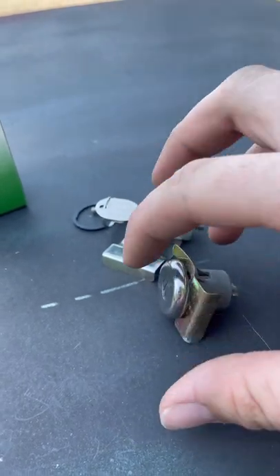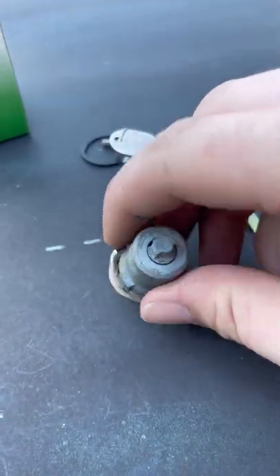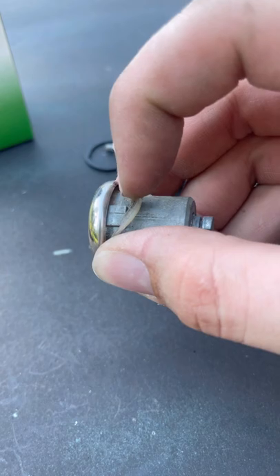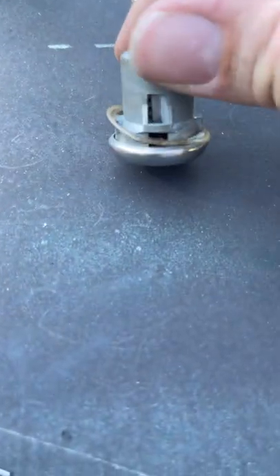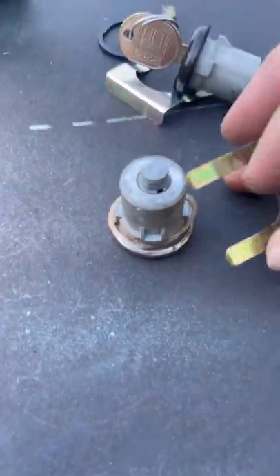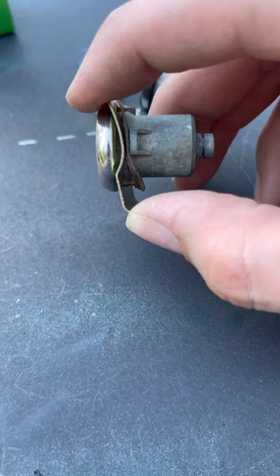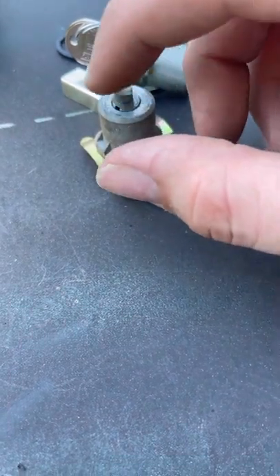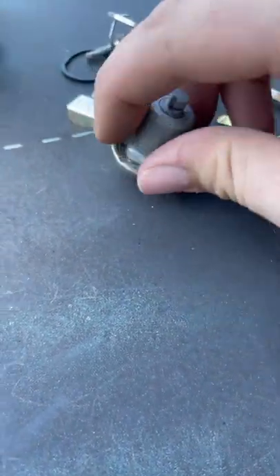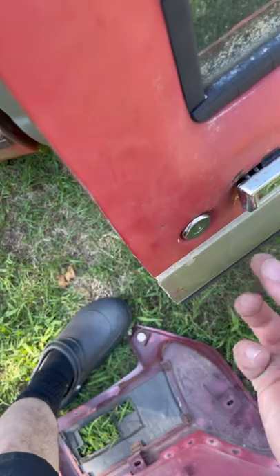For a visual, the door is pinched in between here - there's a little gasket. You can see the old gasket on this one. This is the new gasket for the new one. There are these thick tabs here, and this clip will sit like this between there and pinch - you see how they're bowed towards the door. It'll pinch this between the door. When you pull this clip from the front, it'll hang out.